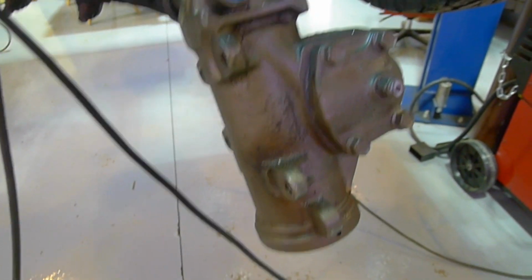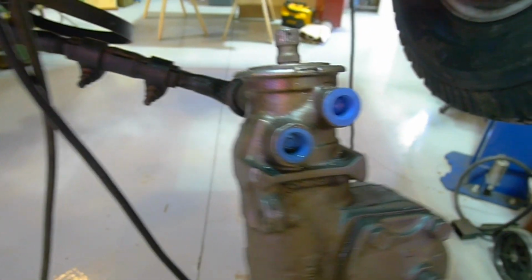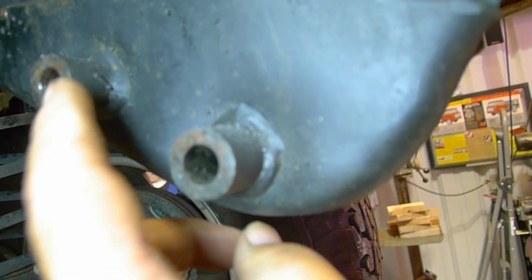So I'm using this right-hand drive power steering box, and I'm putting it on backwards. That was the idea from the Jeep company when they did one of these. To do that, I'm using one of the bosses, I think it's this one, and I'm drilling a new hole there, which I drilled a 1-inch hole, and I'm going to put a 1-inch solid steel with a hole through it up there. And then I also put one more on top of the frame. What I'm going to do is bolt it all in and then tack in this last one so that it all fits.